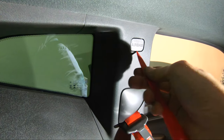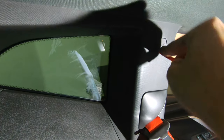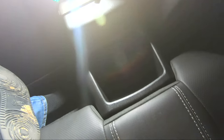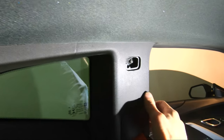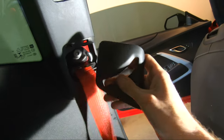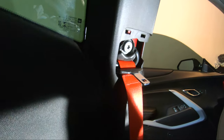So you've got your airbag sensor below here. Go ahead and get your plastic trim tool and pop that sucker out — screwdrivers will chip this up. Go ahead and put it to the side. We're using that little cubby for spare parts. We're gonna have to deal with one bolt in a second, and then we also have this piece which just pulls out. Go ahead and slip your seat belt out of it so you don't scratch it up, and put that to the side.